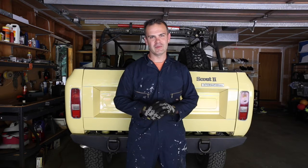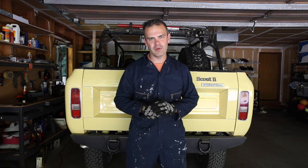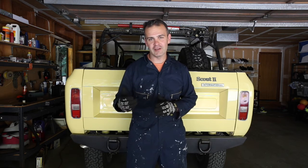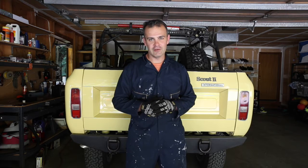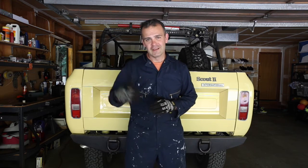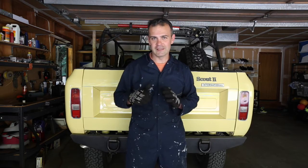Hi, welcome to Matt's Garage. On episode 5 we're going to attack the fuel system. Last time fuel wasn't getting to the carburetor, so I'm going to disconnect the hose at the fuel pump, blow some air through it and see if we're getting air back into the fuel tank. After that we're going to check if the fuel pump's a problem — if it is, I've got a new one from the parts store. In case you're wondering why I'm standing in front of the Scout, it's because Scouts are awesome and I don't want her to get jealous of all the attention I'm giving the Bronco. So let's get into it.